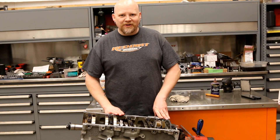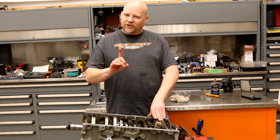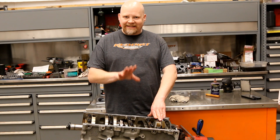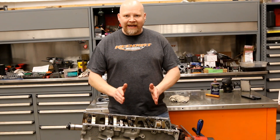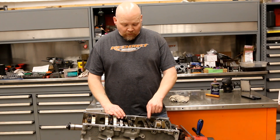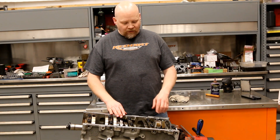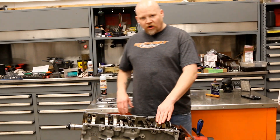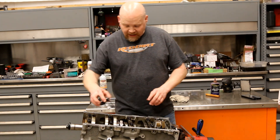This is the first rebuild, so this will be the second torquing of these bolts. There's a special process and we're going to show you how to do it. This is a torque-to-angle bolt — it's not torque-to-yield. There is a difference: torque-to-yield cannot be reused, torque-to-angle can be. The rod bolts and the mains are both torque-to-angle, and we're going to show you how to do that.